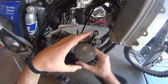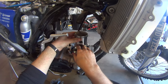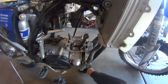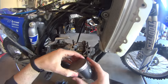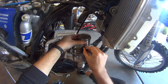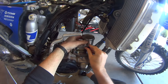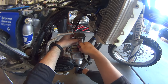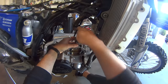I think it's time to install the bearing and the piston on the motorcycle. The piston has a direction - this is the exhaust side, so it has to go out this way. That's very, very important. It's going to go on the crankshaft like this. But before you do that, you have to put the bearing in. The bearing goes inside this crankshaft. The front goes in, then the shaft. The shaft goes through the bearing and it has to go on the other side. It's just an easy, easy motion and then it stops in the clip that we put on the other side.